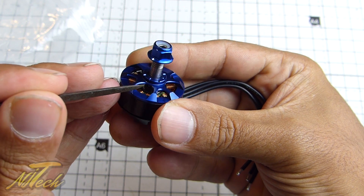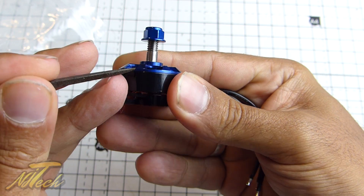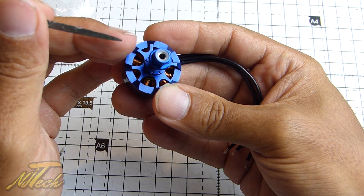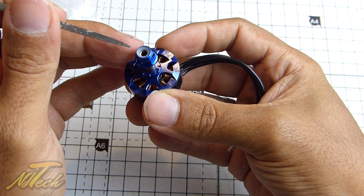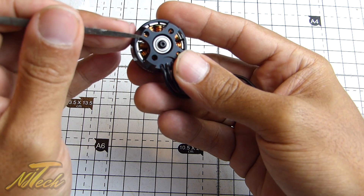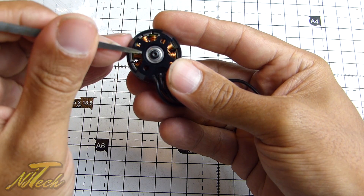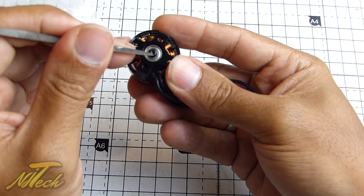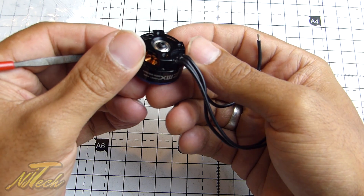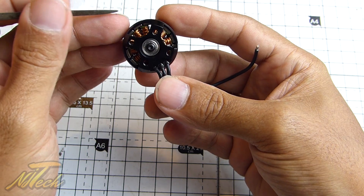It looks like they've lost a little bit of weight by making the material a little bit thinner across the top, but it still looks nice and strong. You can also see they've gone for a hollow shaft, which is great — I think hollow shafts are really good. They definitely give you structural strength advantage, and obviously lose a little bit of weight. Because of the hollow shaft, we don't need a C-clip — we can just use a bolt straight down the middle. The bolt head just makes contact with the inner race of the bearing. That's going to make it really easy to pull apart, service, and pull the dirt and whatever else you crash into out of your motor every so often.